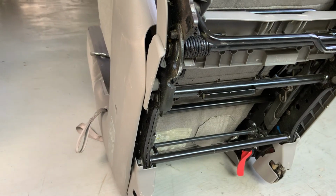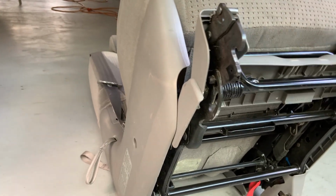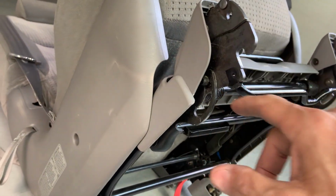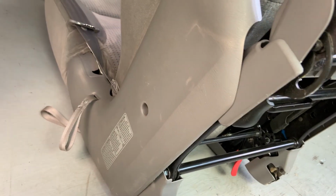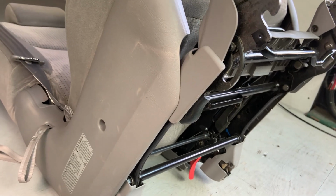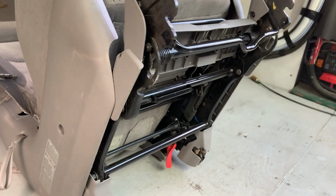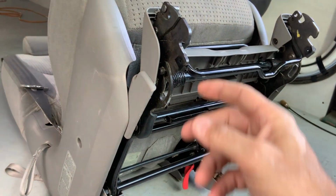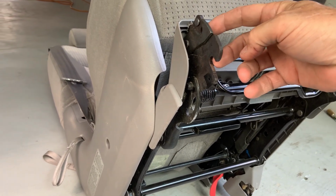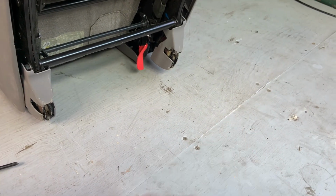It's just spring. So I'm gonna start out making up a model, piece of angle maybe, and put a couple of 3/8 bolts in it with this spacing, and then see if I can push this thing down and learn the angles and how this thing works, and how I'm gonna hook this thing up. I'm thinking I'm going to replicate the original Toyota Sienna mounting pins, there's two here and then the one in the back, on the final fixture that I get.